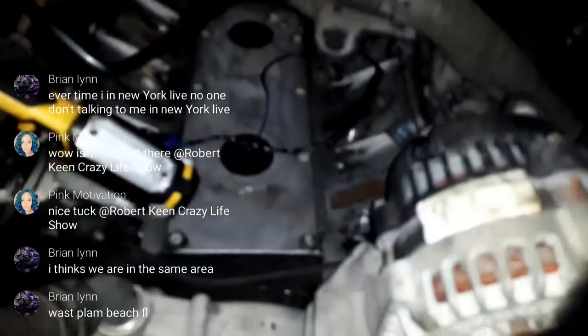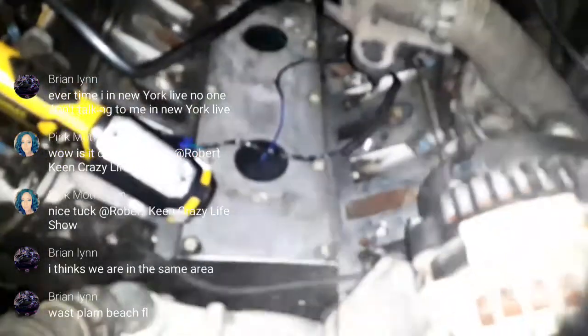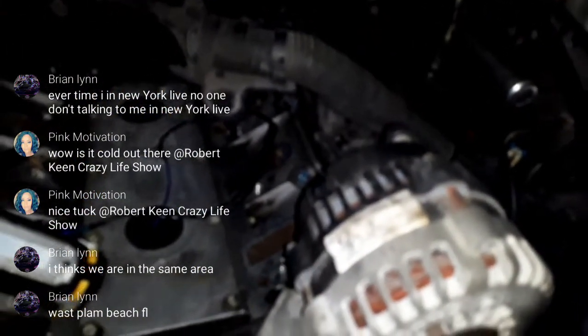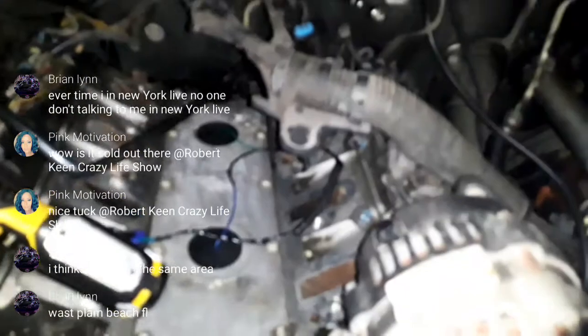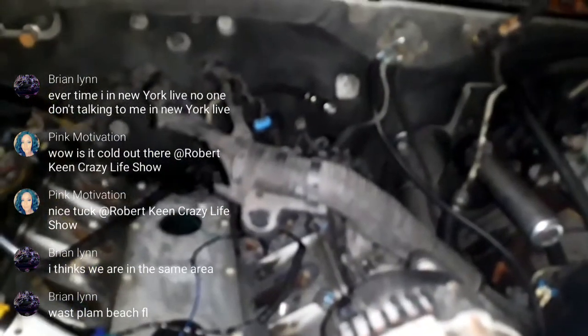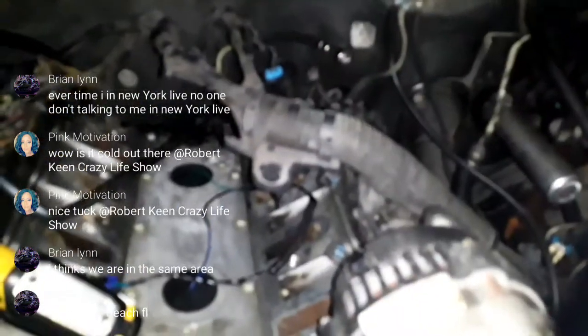So I'm gonna have to take off the spark plugs, get top dead center. Oh, I got 4 people in here now. But I'm gonna have to take off the spark plugs, get top dead center compression, since everything else looks okay. I don't see a bad motor. So at any rate, replace the air intake manifold gasket that I showed in my other live.